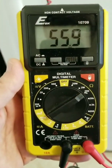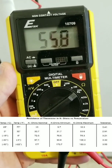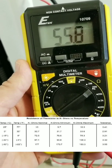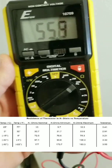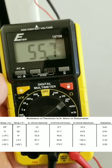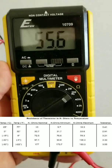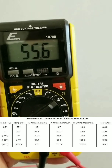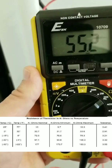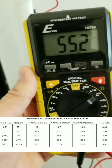This unit is now measuring about 55 to 56 kilo-ohms, because it's been turned off for a little while. That tells me it's reporting about 15 degrees Fahrenheit, give or take 5 degrees. When it's at minus 10 degrees Fahrenheit, it's actually reporting well over 100 kilo-ohms. Be careful, because other documentation you'll find online — even for GE products — may give you a different table of resistance to temperature. You can test the thermistor pretty quickly without taking anything apart at the bottom, letting you rule it out or diagnose it as a problem.